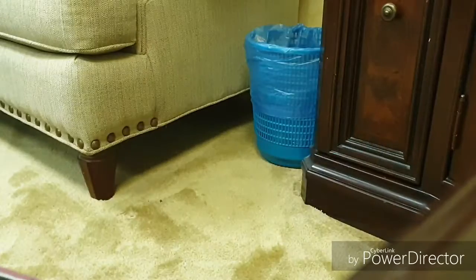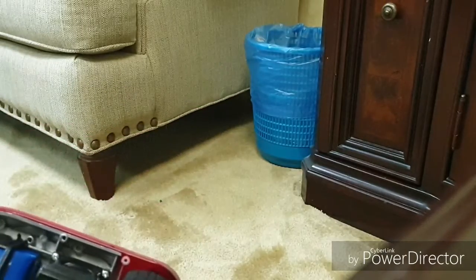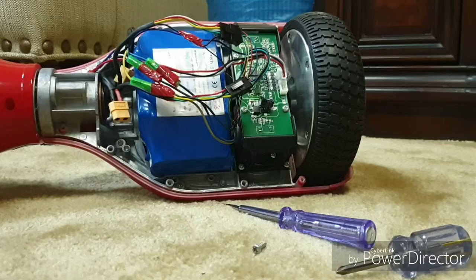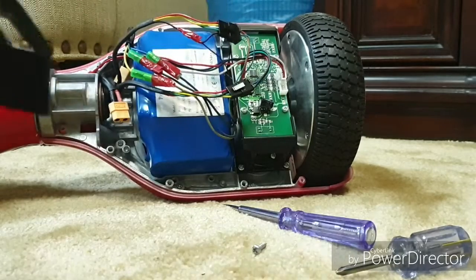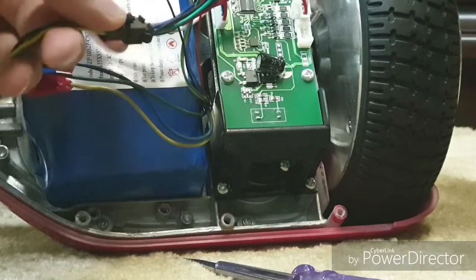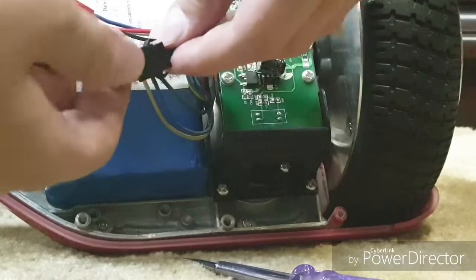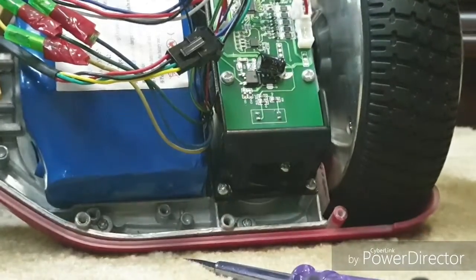The cover is loose now. This cover holds the battery and sits in place. Sometimes you will be able to get it out without removing the wires — in my case it slipped right out. But if you have to disconnect a wire, there's one tab you just hold down and push the wire out. Make sure you remember which wire goes to which connector.